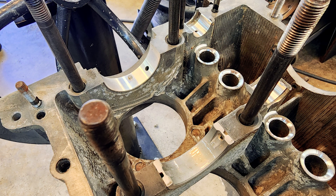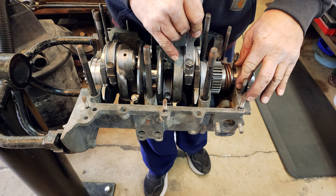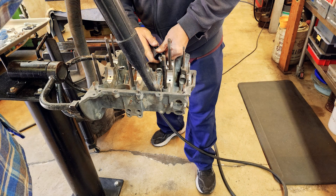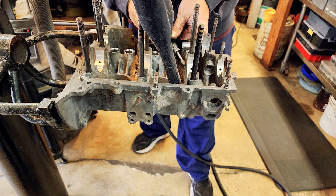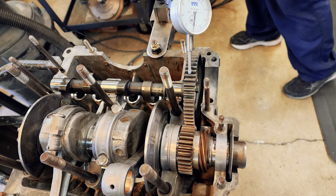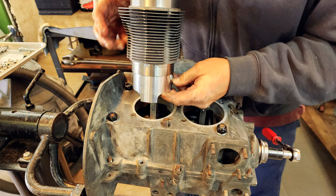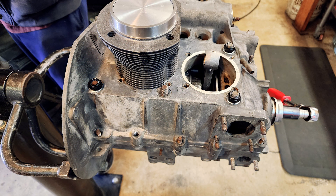He was checking all the bearings and fitment. It's a 1600 so there wasn't too much modification needed, thank God. I just wanted to get an engine finished for the channel to show the head work that my friend Jeff does in his shop. I have a couple sets of heads I want to test with this engine build. We're waiting to finish those heads — right now we're at the stopping point. He put on the pistons and cylinders, checked all that, and we know the sizing and deck height we need to get the desired compression.